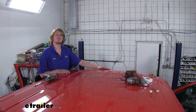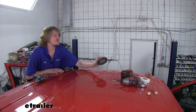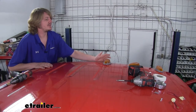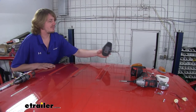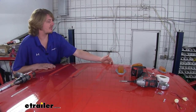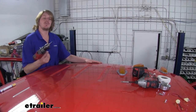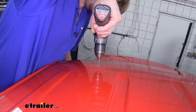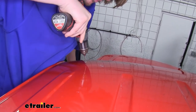To begin our installation, we're going to start by drilling the holes for our lights. You can use the lights as a template. You'll want to find the center first, and then you can space your lights evenly or however you see fit. I've gone ahead and drilled out the holes for our center one and the ones around it. We're going to drill our last one here using an 1/8-inch drill bit. You want to be careful not to go down too far with your drill bit, as you can poke a hole in your headliner.